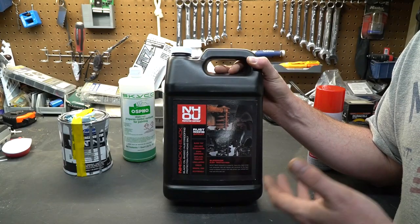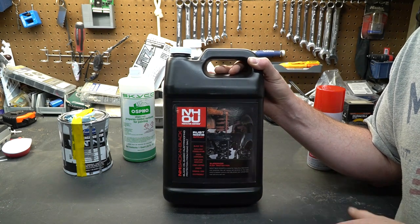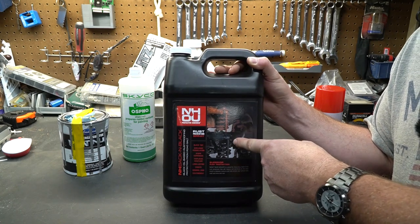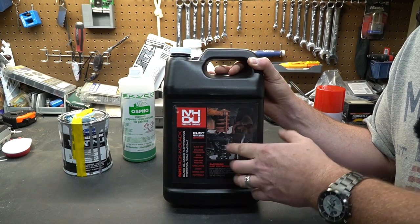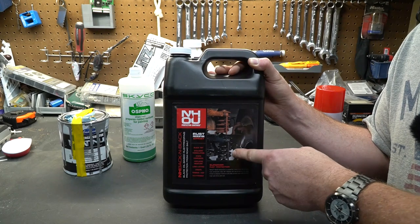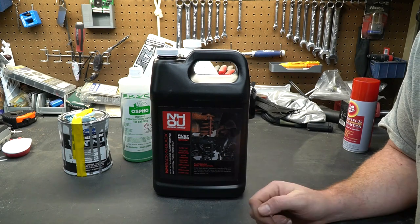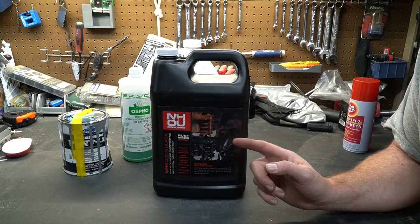This is New Hampshire undercoating — it's an oil-based undercoating. It seeps and creeps into areas you normally can't get into, and if you have existing rust that's really bad, this is what you want. It'll soak into those rusty areas and prevent further rust. It's kind of like bar chain oil — a little sticky and tacky, and it's dyed jet black, so after you paint it onto your frame it looks like you painted it black. Obviously you can't use a product like this everywhere; if it's something you need to handle or touch you definitely don't want an oily substance on it. But on a vehicle frame it's perfect.